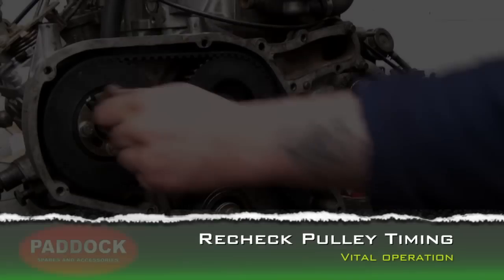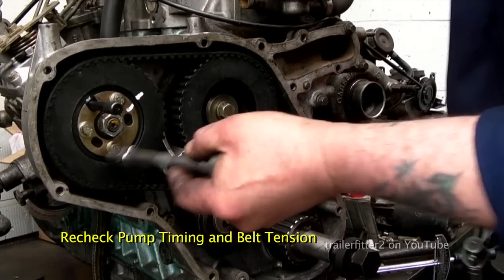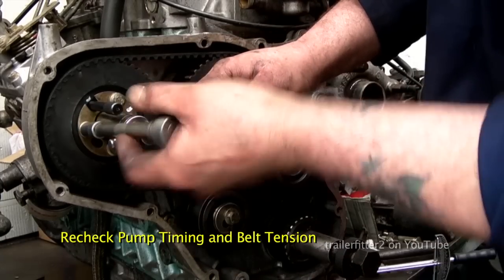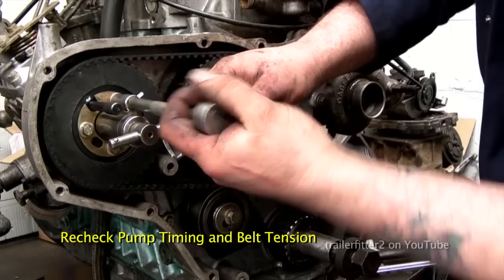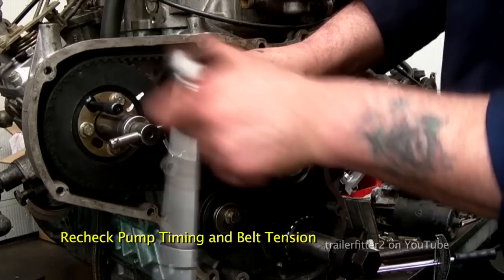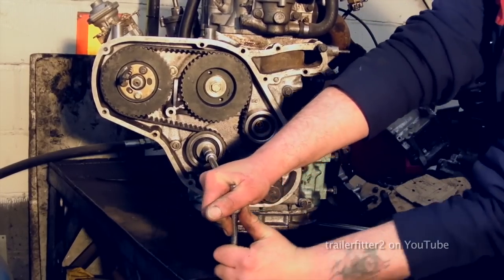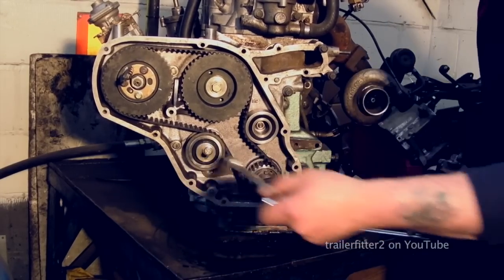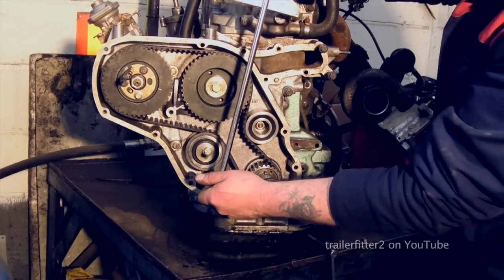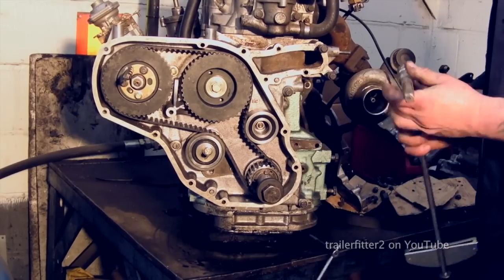All right, making sure that the crankshaft's correct, the camshaft marker is right, and you have the timing pin back in for the fuel pump, undo the three bolts which lock the locking plate. The second thing you need to do is to readjust the tension on the idler. This is important. Once you've set it right, then that should be all right for the next 5 years or 100,000 miles, depending what you need.